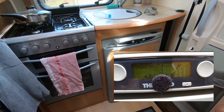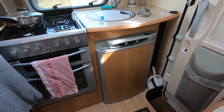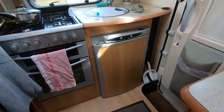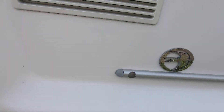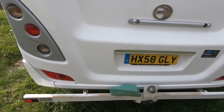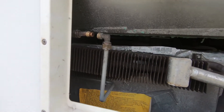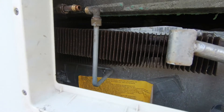I've got to investigate that and see if I can find out what the problem is. The first thing I have to do in our van is remove the fridge from under the counter - nothing is accessible otherwise. Outside, at the back of the fridge there's a grill at the top but no grill at the bottom. I've done a little bit of prep work: under here you can see I've disconnected the gas, because it's a metal pipe and it doesn't stretch.